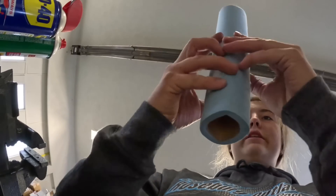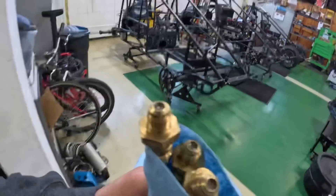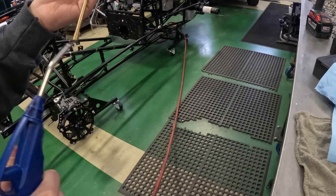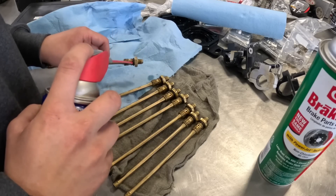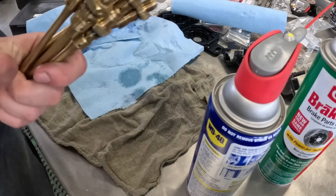The injectors are done, so I'm gonna go get them out of the ultrasonic tank. Get some blue towels and set them right on top of the lid. All you gotta do is spray them out, then hold them up to the light — if you can see straight through them then they're clean. If there are particles in there, that means they're not clean. Right around this black O-ring, just spray a little WD-40, and also up where the lines go, just to keep everything good. My dad looked at them and he said they looked good.